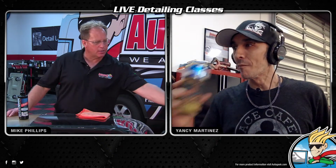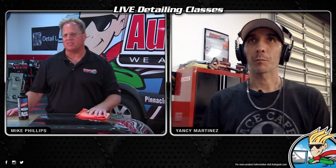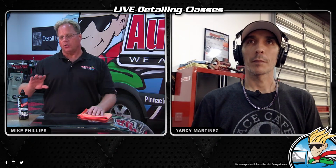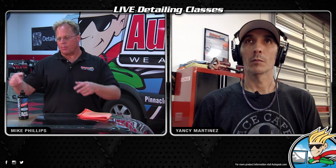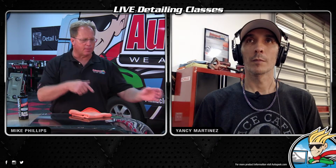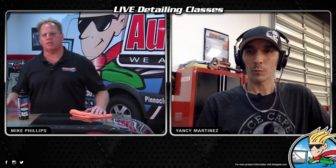And if you go in there and you try to just clean it with a spray-on glass cleaner, usually it's not effective and it's messy. So instead, go in and hand polish it. And here's what you're going to do. You're going to easily mix that film up with the polish, and then when you wipe it off, you wipe the whole mess off at once, then come back and finish it off with the glass cleaner. That makes sense. And you can do this for all the glass in the car.